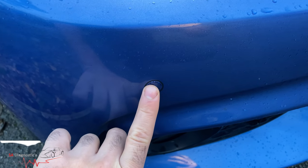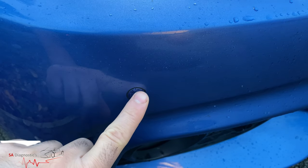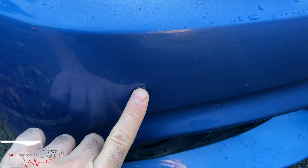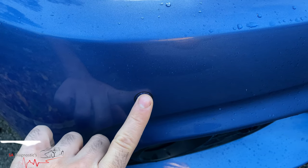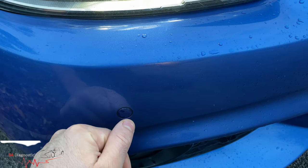What you'll need to do is touch the parking sensor and you'll get this kind of pulse — it's like a little heartbeat, shall we say. You'll feel it on each one. Just put your finger on it and wait for the little pulse. If one doesn't respond back, that means it doesn't work.